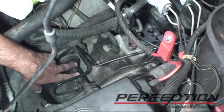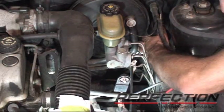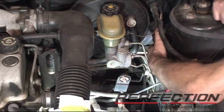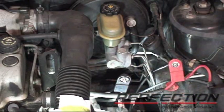Notice this slave cylinder does not have a bleed screw. The clutch master cylinder pushrod attaches to the clutch pedal arm with a clip. Remove the clip and you can take the pushrod off the clutch pedal arm. To remove the master cylinder from the firewall, locate it and give it a turn clockwise — the whole system comes loose. Carefully pull that out, disconnect the slave cylinder and the damper, and the whole assembly can come out.